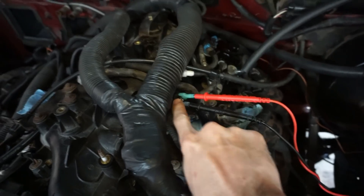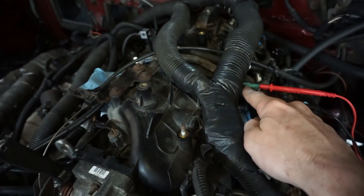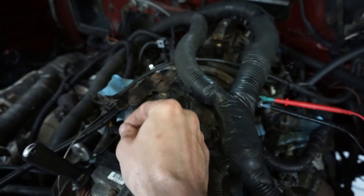So I've got a couple options now — the ignition cut, the PCM relay cut, or the timing pull. I kind of like the timing pull idea because you'd be able to feel it kind of fall on its face and get out of it. The switch would be right here and the intake air temp wiring is right here, so it basically just wouldn't need any relays or anything else — just wire this into that, connecting these two wires when that switch closes, and that would pull all your timing out.